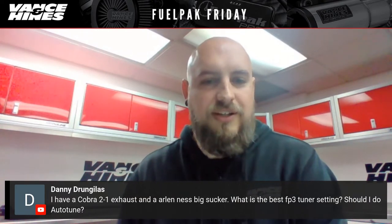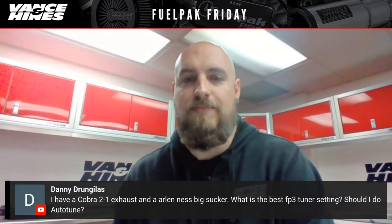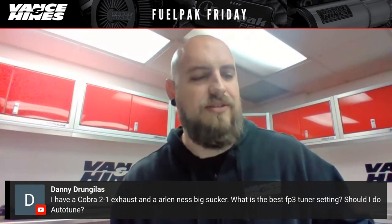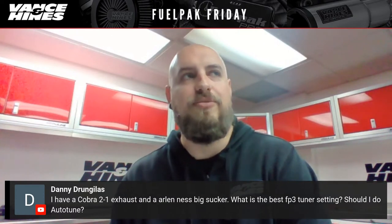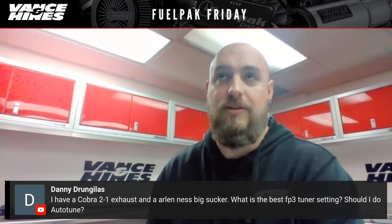If it's something that's more akin to a pro pipe, a longer 2-to-1, you could just use a pro pipe map. Nine times out of 10, people aren't going to have the same type of baffle complexity that we're going to have. So I would run with the competition baffle map on a pro pipe, something just wide open, mechanical, no packing, no multi-chamber, that kind of stuff. So I would run competition baffle pro pipe. If it's something shorter, depending on the bike, it would be either a competition 2-to-1 or a stainless 2-to-1, one of those shorter 2-to-1s that we offer.